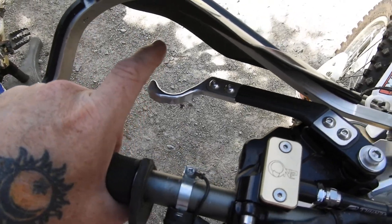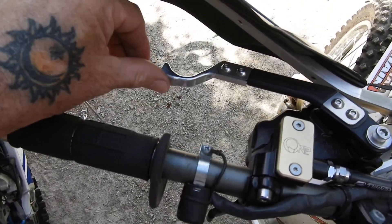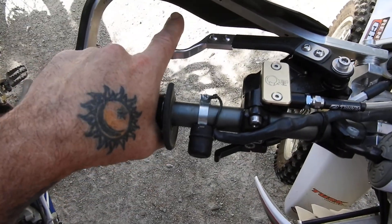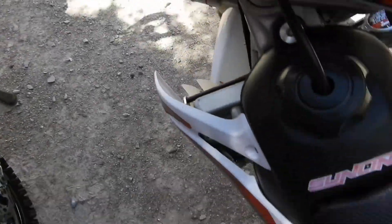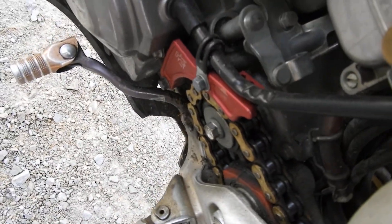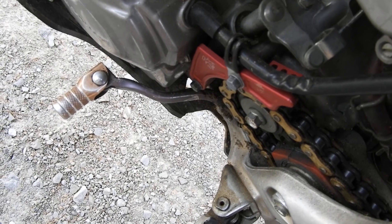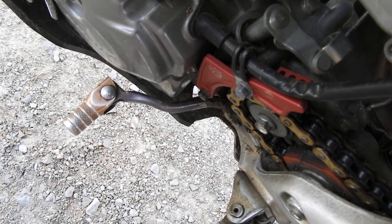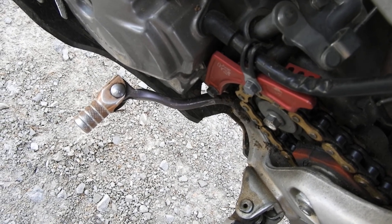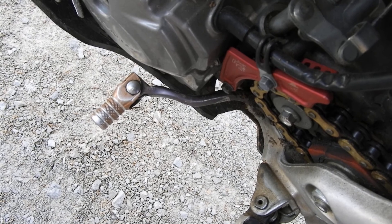That I was able to gain by removing that nub that was over here. I don't think I re-welded this in any way, other than just reworking that. It increased my actuation amount. I always use this down here — you see how that opens up against the red back, the chain casing protector there. I use that as a reference when I'm standing here adjusting, fiddling with it, just to see how much I'm actually opening up the clutch plate.